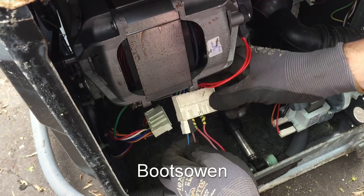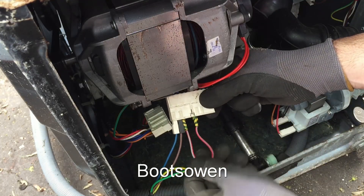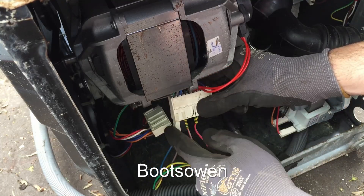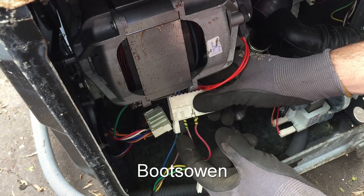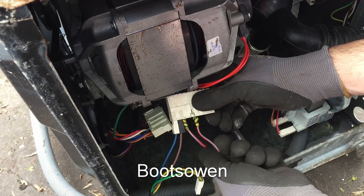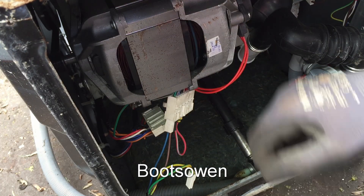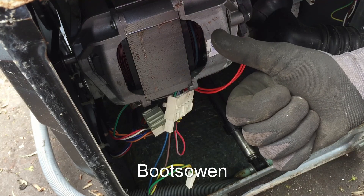I've got the power in — the brown going into the grey here, so that's going into a coil. Then I've got the little jumper cable going from the blue coil to the pink. And then the neutral is going to the green over on the left. So you want the power coming into a coil or a brush, jumping from a brush to a coil or vice versa, and then coming out through the opposite one. Have a look at my other video for how to wire these things — I'll put a link somewhere. Questions or comments, leave them below. Thanks for watching, see you later.